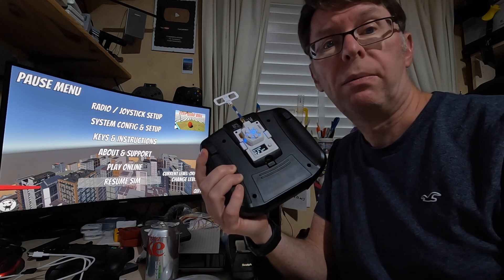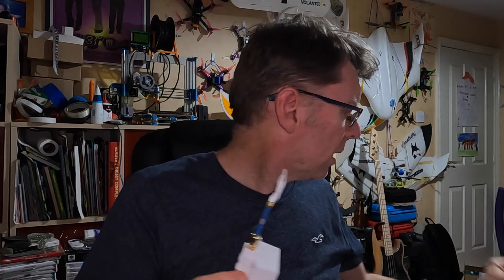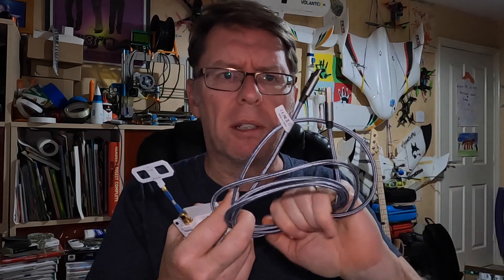One quick thing a lot of people mentioned is the recessed USB cable. I bought a bunch of pretty basic USB-C to USB cables that I've been using regularly and those were able to slot in without a problem. I was looking for some sort of fatter ones and found an OTG cable — those have an extra resistor to make them OTG — and that is a bit fatter and doesn't go in; it just sort of hangs there. So as long as you've got a thin cable it should go in. Normally you'd use USB to update it, but I generally prefer Wi-Fi because it's more convenient.